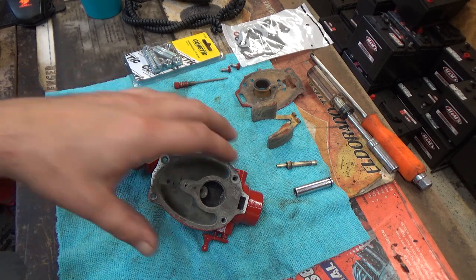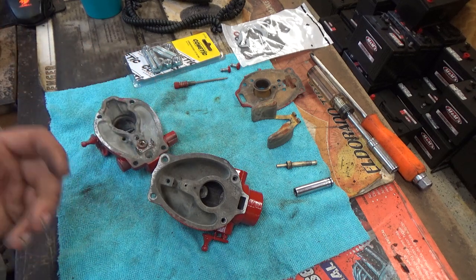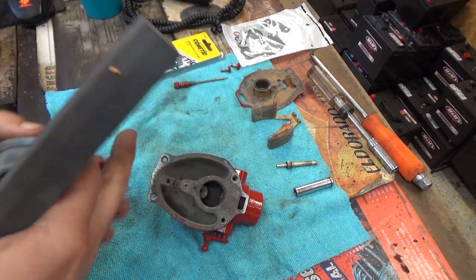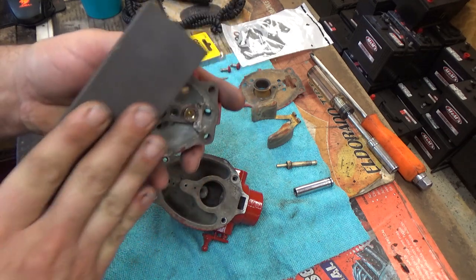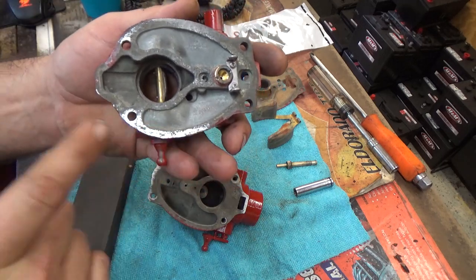There's really no reason to go finer, because the more roughness you have is good for biting into the gasket and sealing it. But what we're working on is a flat surface. You've seen where all I've done is gone across this flat surface just like this with this block. I've only done this for about a minute, but you see the shiny spots.